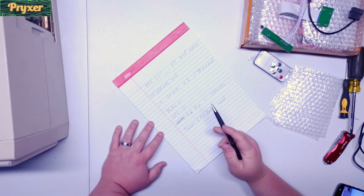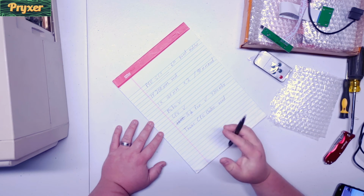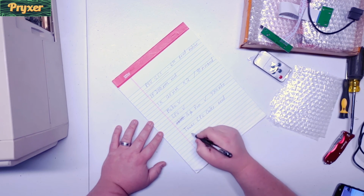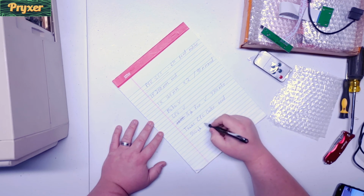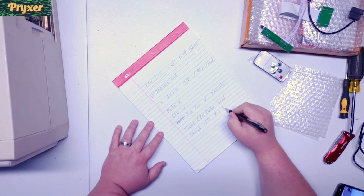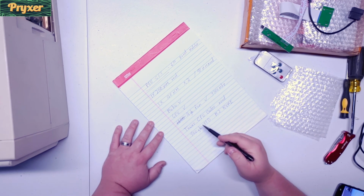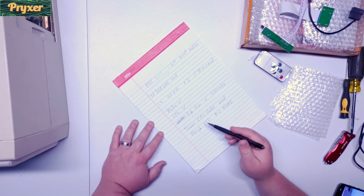All right. Next up, we're going to need an SSD. So that motherboard has at least one M.2 slot on it. So let's get a 500 gigabyte SSD, preferably an M.2 NVMe, so it's nice and fast. That should be enough room to store a few games on here, the operating system and a launcher.